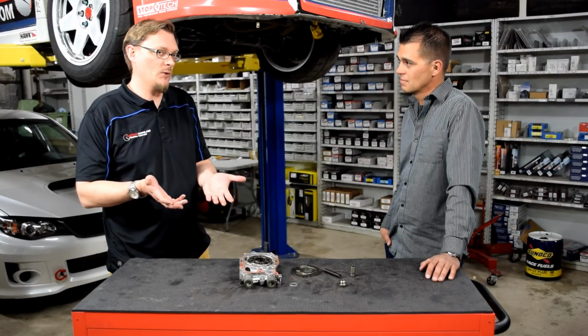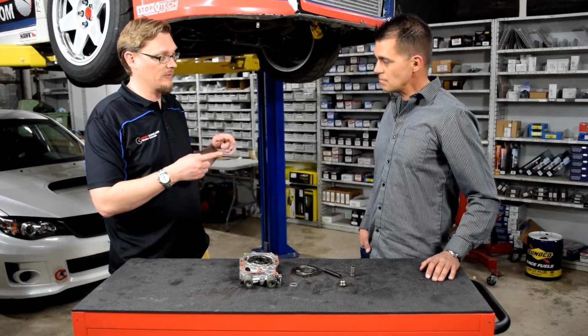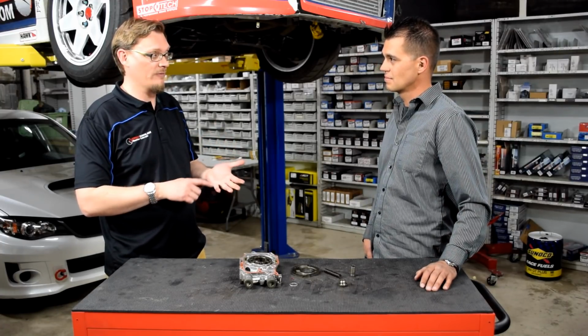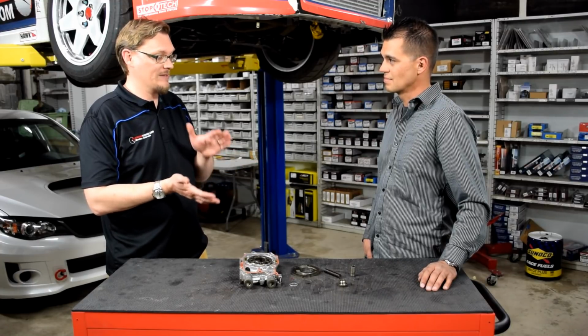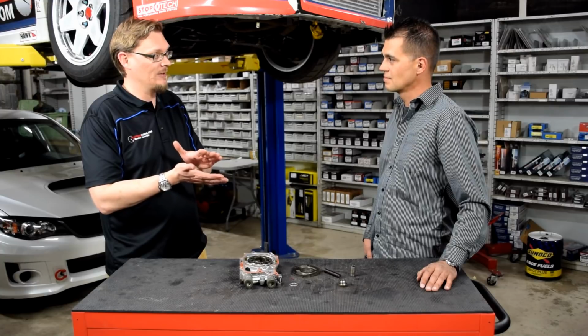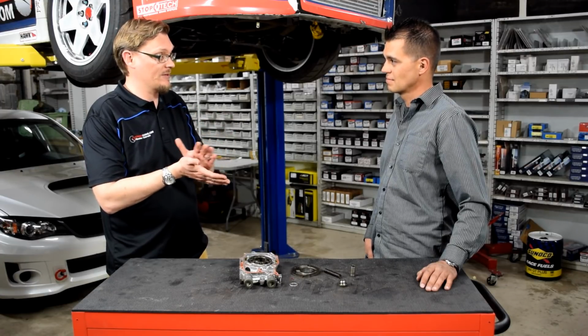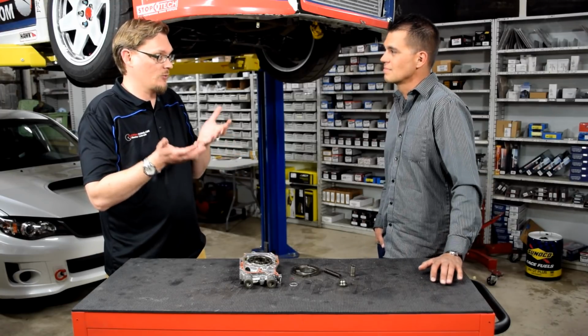And I mean, just a quick note, the significance of that pressure is because that oil pressure going through the engine, that's what's creating the cushion of the bearing for your engine, for the mains, for the rods. So where you have a target pressure, it's because that pressure is the cushion of oil between the crank and the bearing surface itself. So you want to have it be a certain target pressure because that's what is creating the bearing.